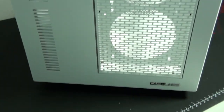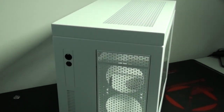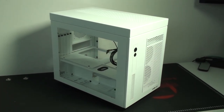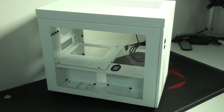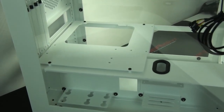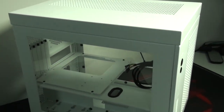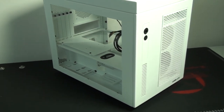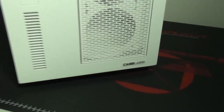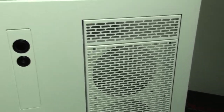That extra space allows for more modding possibilities and all of the different customization options available. It also allows for the installation of more water cooling components, and that's something I look for when choosing a case for a water-cooled build. One of the first things I look at is radiator capacity, and so many cases have such restricted radiator capacity - that's why I often turn to CaseLabs. They have incredible radiator capacity, even in the smaller cases. With the Mercury S5, you only need to add a pedestal and you can add another two 360 millimeter radiators. The Mini-ITX version, the Mercury S3, can still fit a couple of 280 millimeter radiators without the pedestal.